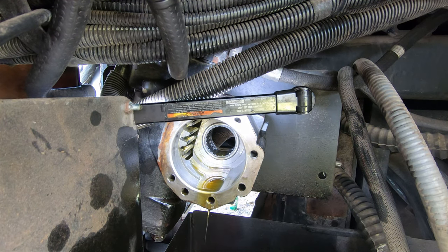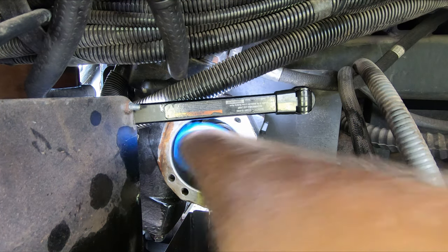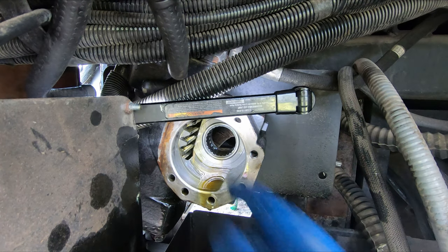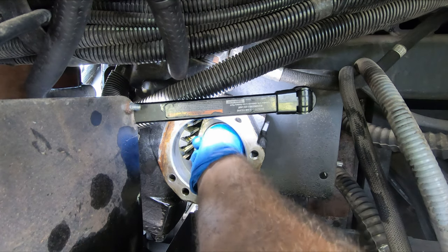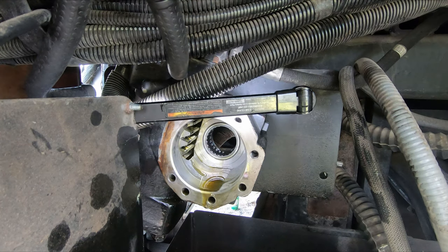So as it turned out, I spent a bunch of time talking to a camera that's not up and running. But I got the seal in, and how I did it was I put in first the black seal, and then I seated the white Teflon seal into it. When I run my finger around, it feels perfect. There's no bumps or ups and downs, and the seal's covered with oil, and everything feels pretty good. So now I have to move on to reinsertion of the sector shaft.